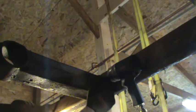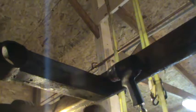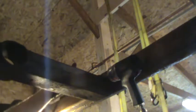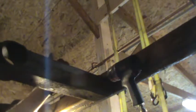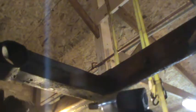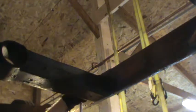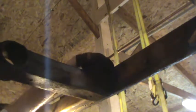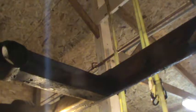1/2 inch head on a bolt that goes through to the other side, and it's held on with a 9/16 nut on the other side. It's kind of rusty, so I don't know how far I'm going to go with the impact wrench. Came off easy. There's a washer on the other side. Bolt comes out,